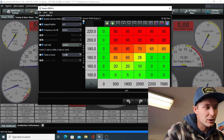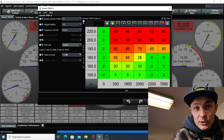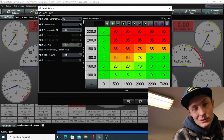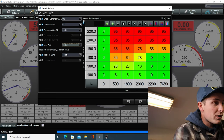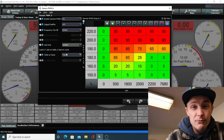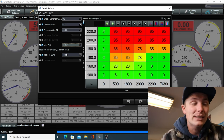95% is the highest duty percent, and at 5% the fans basically won't come on — it's effectively off. That's how my table works, and that's all you have to do to set it up in Tuner Studio. It's super straightforward and easy.